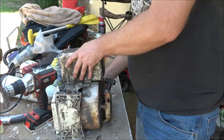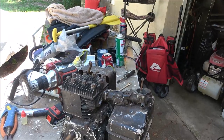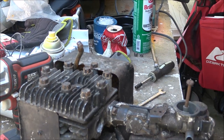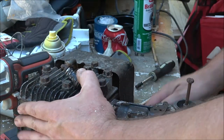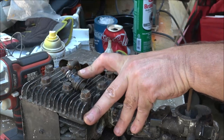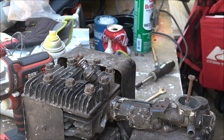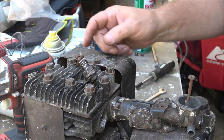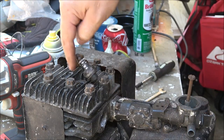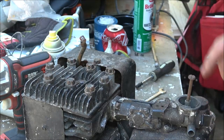All right, now what are you guys looking at now? Let's get you down here. Maybe I can... don't know if this plug is any good or not. I know you guys can't see that, but I can see it and I can feel it. All right. Get the plug in here. And we use our little squirt thing. Let me get it down on the ground. And we'll squirt a little gas in here. Put the plug in it and see if it'll fire off. If it fires, then we'll put some gas in this tank.